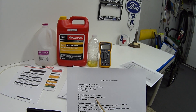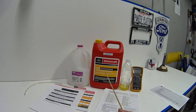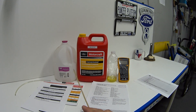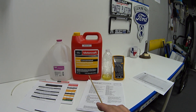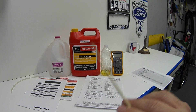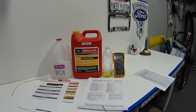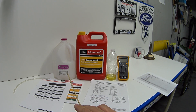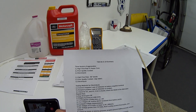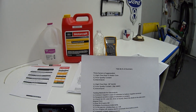Regarding poor quality coolant — I think people are adding coolant and mixing it 50/50 with tap water or well water instead of distilled water. Tap water contains hard water minerals and debris that, combined with the high flow rate, act like microscopic beads of sand wearing away parts of the heater core. That reiterates how important it is to use distilled water for coolant service. As for electrolysis, I'm not exactly sure how it contributes to heater core leaks, but Ford has clearly identified it as a factor.